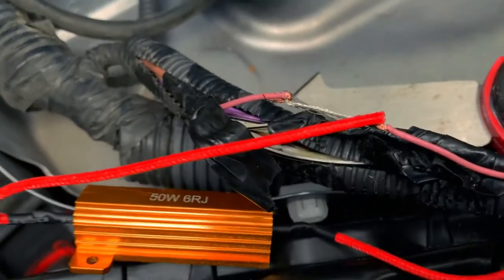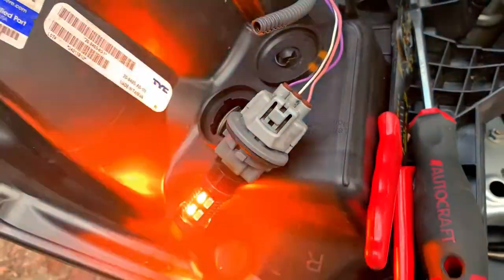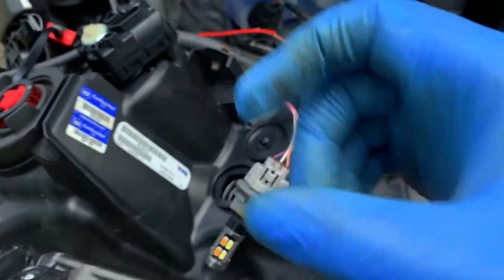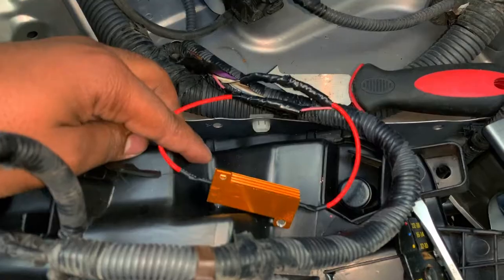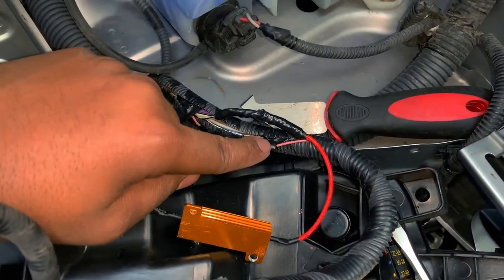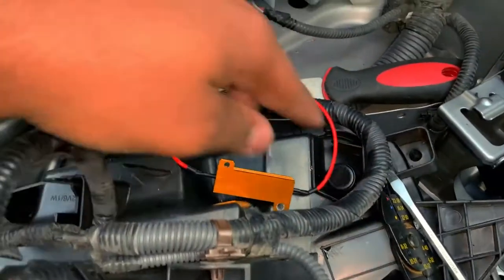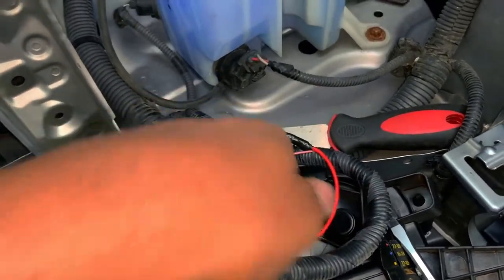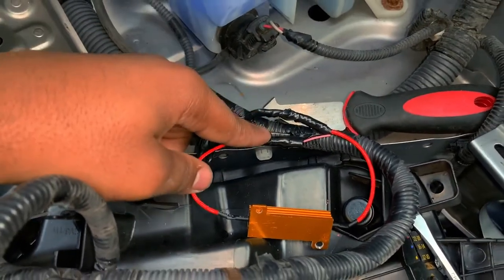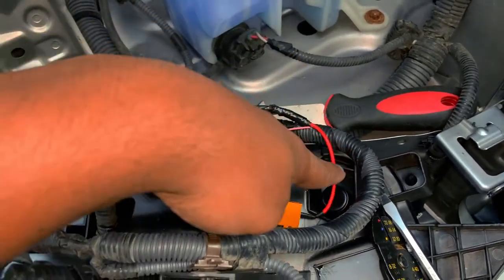Pink for blink, white and black for ground. The white and black I'm using doesn't have to be that specific one - it could be any white and black from the headlight area since the headlight white and black is thicker. This end of the resistor goes to the pink wire, which is the blink wire, and this end goes to the white and black ground wire. It does not matter which side is which - you can flip it. Just make sure one side is on your power for blink and the other on ground, and do not connect both ends to each other.